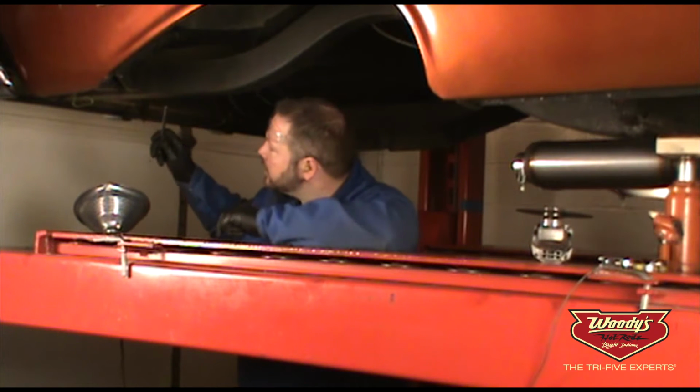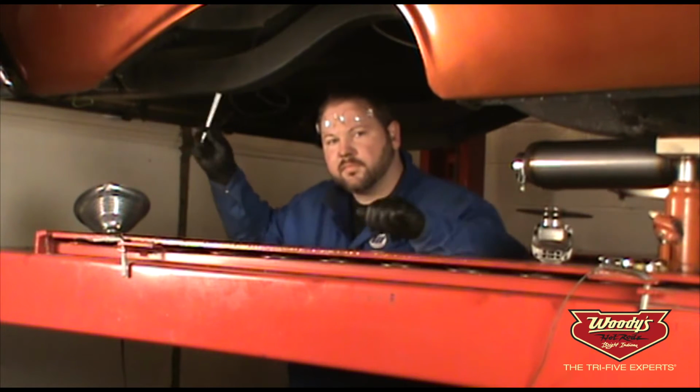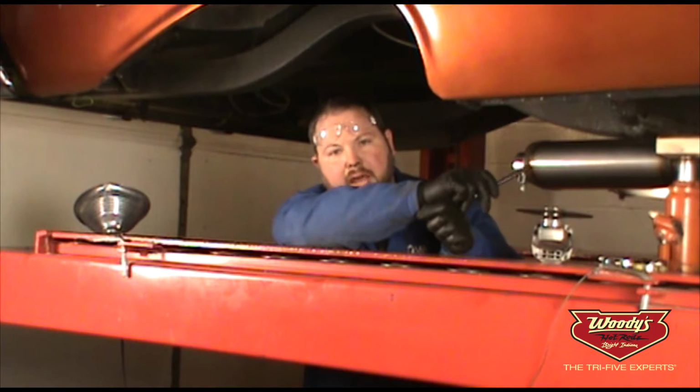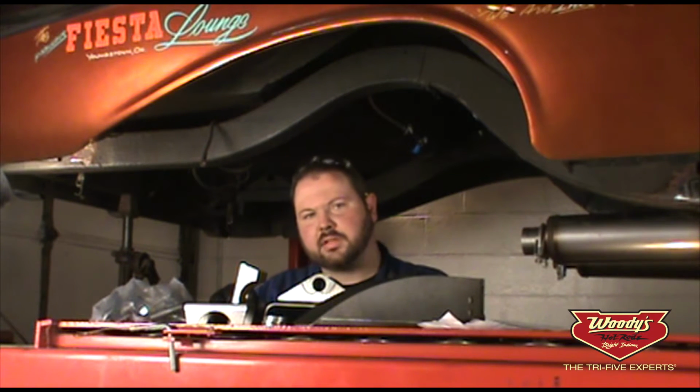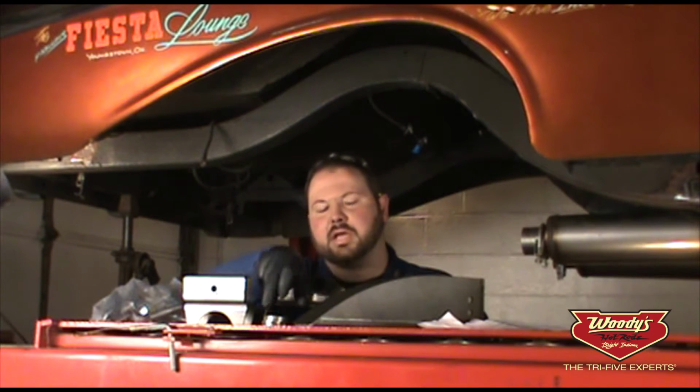What we're going to do is remove, by cutting off, the rear leaf spring mount in order to make room for the new one, along with the forward leaf spring mount, so that we can start cutting out the pocket itself for the relocation kit. Here we are with our 1957 Chevrolet that we're installing the POL brand leaf spring relocation kit on. It comes with everything to inboard the leaf springs on an axle on these cars, including the axle spring perch, which you can weld onto the axle. We've actually opted for the Johns 9-inch that already has the spring perches welded on along with our pinion angle.